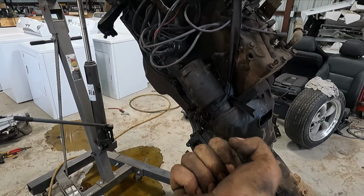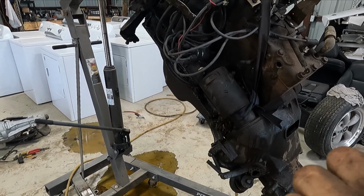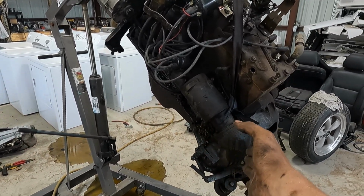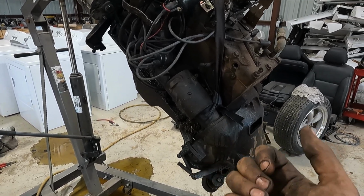And there was a pull cable on the dash. So once you got up to a certain speed, you wanted to cruise, you pulled that cable out, and if you wanted to pass somebody and you floored it, it would pop the overdrive off for you, and then when you want to go back into it, you just pull the cable back out.